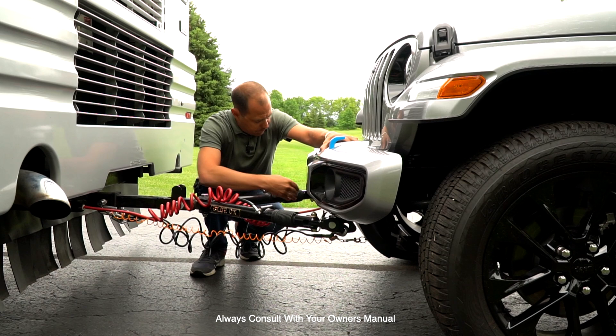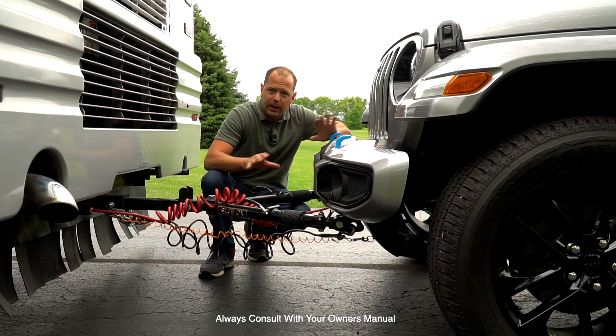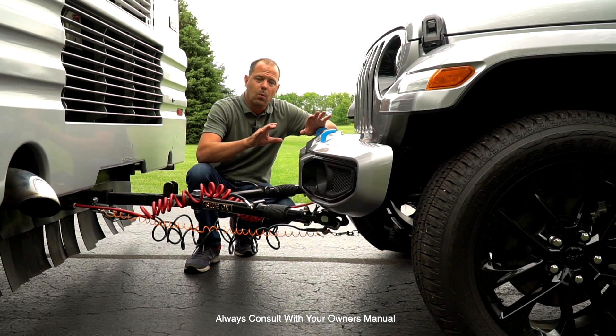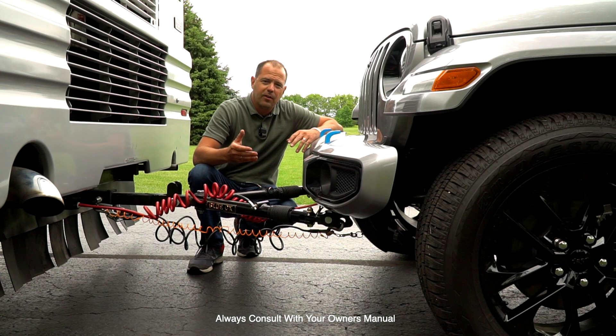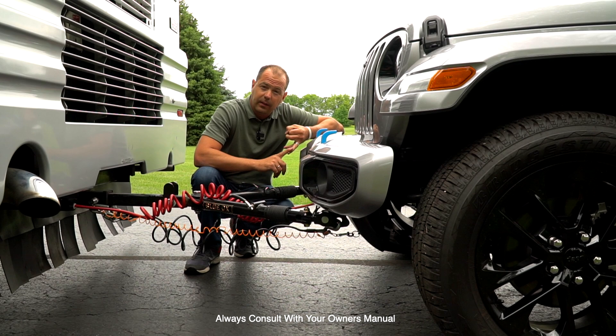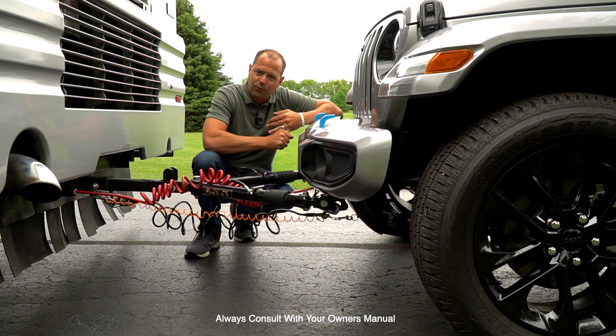This video is lengthy — we've taken our time doing it — but if we're ready to go on the road, between Charlie and I we can have this thing going down the road in about four to five minutes. As part of my inspection when I leave, I'll always have my wife walking around the Jeep making sure all four tires are spinning. It confirms the transfer case is in neutral, you didn't leave a parking brake on — just a quick double check. Definitely make sure you're not in four low; the transfer case has got to be in neutral and the transmission in park. You do not need to leave your key in the Jeep — it can be off.